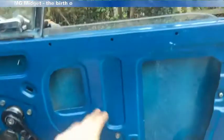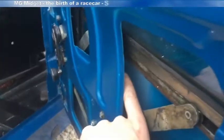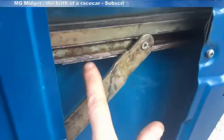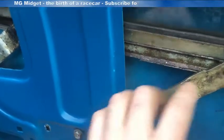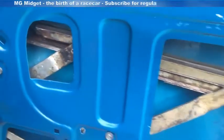And then once you've got all that in place, the next step is to fit the glass top runner to the top of the regulator, and there's a slot halfway along here which it has to go into. So at the same time as you put it in the back track, you put it in the middle. I think you can just see the beginning of the hole here. Slide the window along, and as you slide the window along, you can manipulate the window regulator into position.